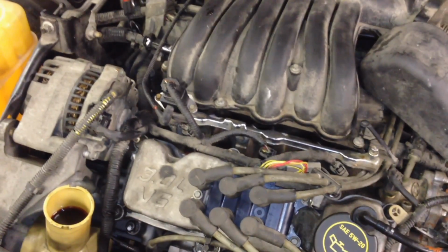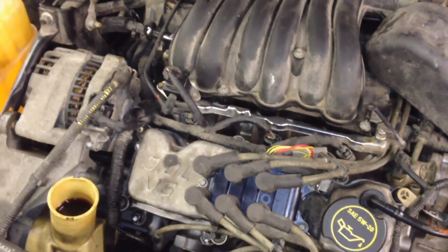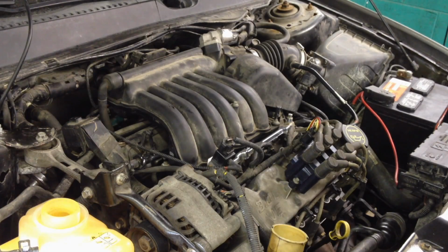And that way we've got pressurized lubrication, the oil filter filled and all that, and we'll also get the splash lubrication up on the top end here before we even think about starting the engine. That way it's pre-pressurized, basically. Alright, we're going to go crank it, and even if the oil light does go out, we're still going to crank it for 15, 20, 30 seconds either way.